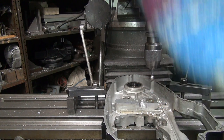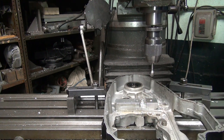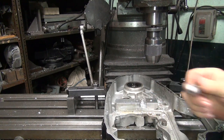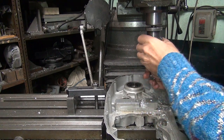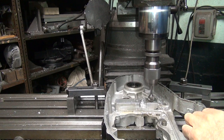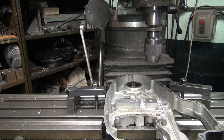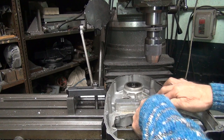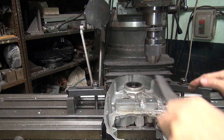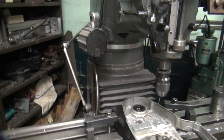Wait, you gotta rotate that direction. And it cuts the first thread out, but doesn't leave a very good surface. It doesn't want to cut. Go back to my standard ball mill I like. Fast, you gotta slow it down. Alright, so that's three different chamfers in one hole. Go back to the one I always like anyway. Take our file and just knock off any fine burrs that are left. Not too much left. Cleaned up. Okay, vacuum up the chips.